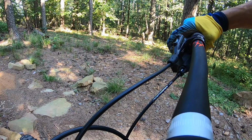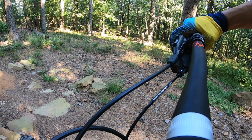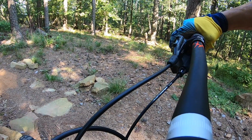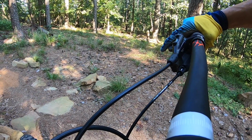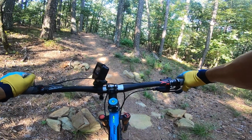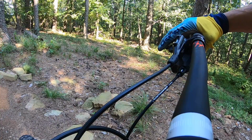There's a little bit of resistance because of that fluid buildup in there. But until you get to the 3/4 mark and then you squeeze, that's when your brake really starts to engage. And that might be a downfall for some people, just because you can't adjust that. And the left side's probably even worse because of how squishy it is. Now, if you go to bleed these, maybe you'll get a little bit better performance and not so much lag in these brakes. Maybe there's air gaps or air bubbles in there.